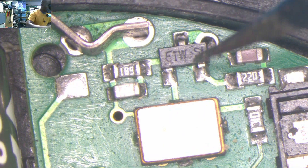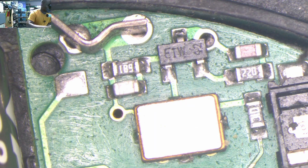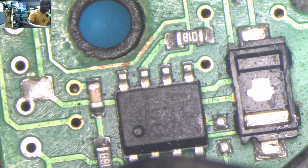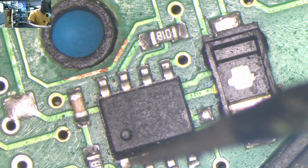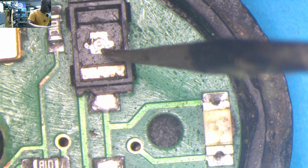We have the battery — this is the battery, plus and minus. After the battery we have this resistor, and this looks like it's a small transistor, ceramic capacitors, and that's the crystal. We have this chip — it looks like a MOSFET — but it is a chip which is controlling these two switches. You can see here: we have this switch and this switch.